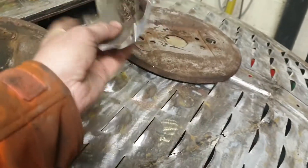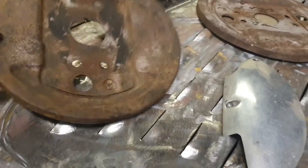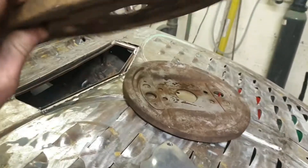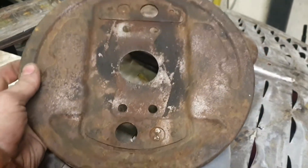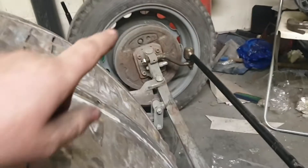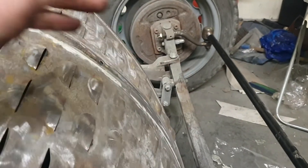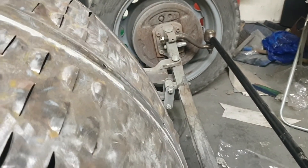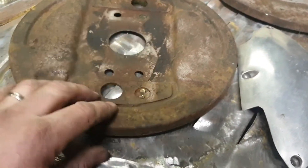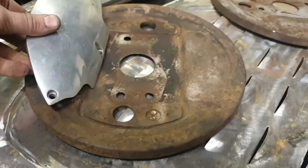These are British air scoops to go on the brakes. I've just picked up a set of really nice solid backing plates — these are late split, like '50s ones. The ones on at the moment are a bit rusty and crusty in places where they've gone really thin, and they're also a little bit bent. So instead of messing around with them, I've just got some more. These are going to get shot blasted and stuff.